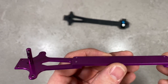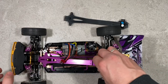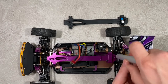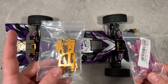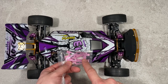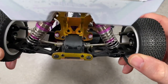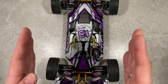If you don't want much work, just put them on as-is and you're fine. Even if you want to raise up the canopy for a bigger ESC for speed runs, take them like they are stock — you don't need to cut and drill them. Now it's time for the A-arms — the front arms and the rear arms. They are more pink than purple, and here's one big issue from factory: the tires go inside, which is better for cornering. But we're going to change these two plastic parts and this metal part so they will be straight — very good for high speeds.